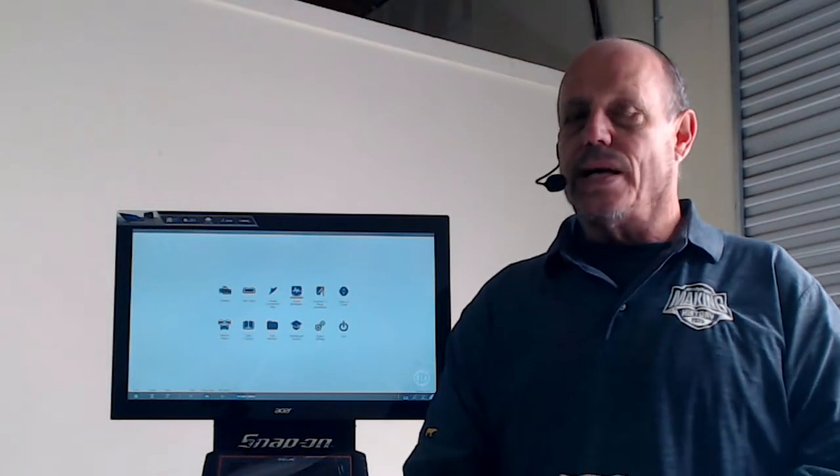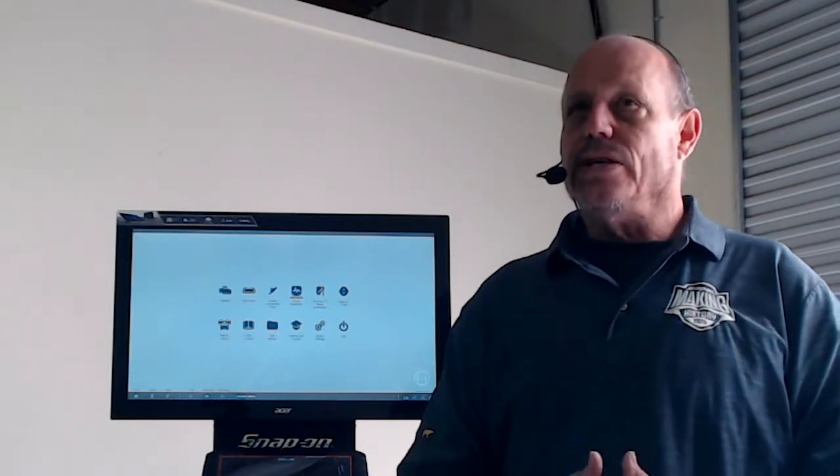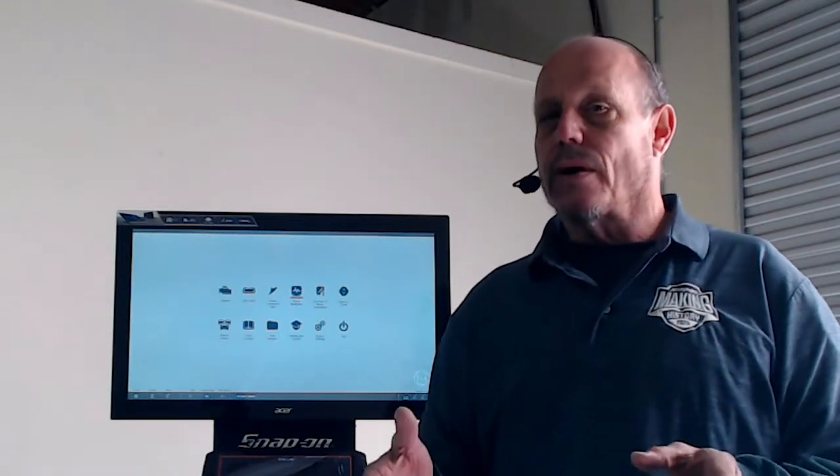So what I'm going to do today is teach you how electric works on cars, and how you can use a scope on cars. We're having issues today with just changing out parts that don't necessarily need to be changed out. If we can learn what the voltage should be on the part, or how the part functions, you're going to be able to fix the car quicker and easier. So if you know the voltage on the part with a scope, then you're going to know what the voltage should be on the scanner, which makes it a lot easier, because then you can just isolate the problem.